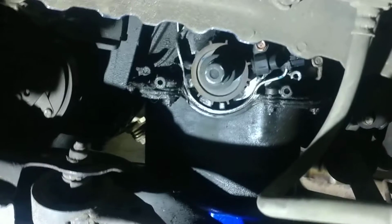So the first step of all this is to get your car in a nice spot to do a lot of this tear down. You're going to jack up the car. You're going to get the front driver wheel off, which is going to give you access to the driver's side wheel well area. There's usually a cover right here that blocks the view of the crank bolt and crank pulley, which looks like that. There's your crank pulley, and notice that this crank pulley has a 6-pointed hold hole, unlike the early 90s generation.